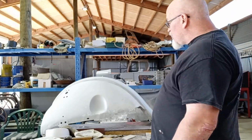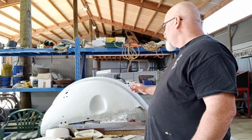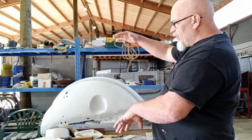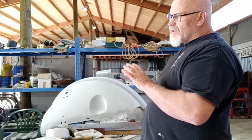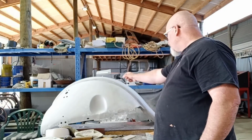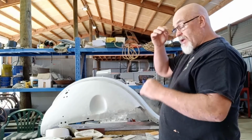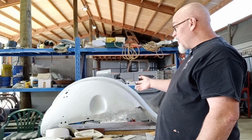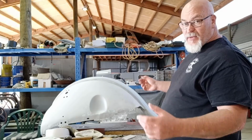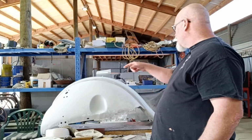I think it's just because they're so curved that way, and then they get the line in them, and then they curve again. This piece here doesn't really worry me too much. That's pretty easy to work on because it's a biggish area. Even though it's curvy, it's an easy thing to sand, whereas this little strip edge, trying to keep that line nice and trying to get the definition back in that line after it's been beaten to a pulp and then straightened out, and probably over beaten in places because, as you've seen, I had to shrink parts on the back fenders, and I've had to try and beat these into submission.